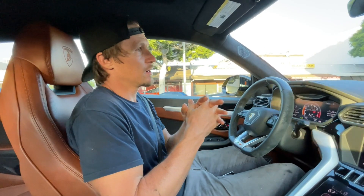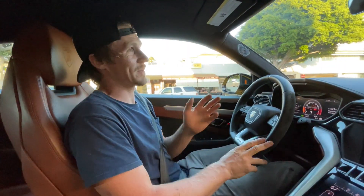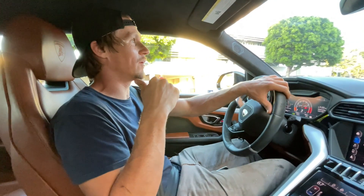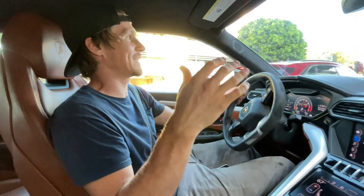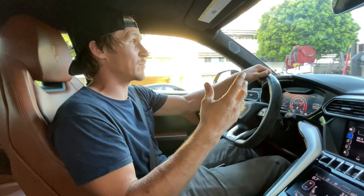If you go to the dealer and tell them your brakes are squeaking really badly, one of my favorite jobs when I was at the dealer — they give the car to the tech and say, 'Hey, brakes squeak.' We go out and just drive it hard and get the brakes hot, and that way it actually burns off that brittle layer.